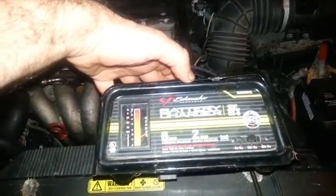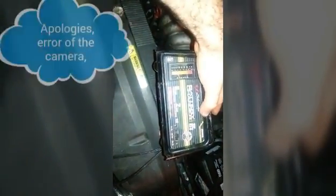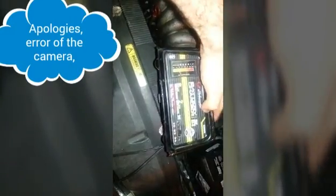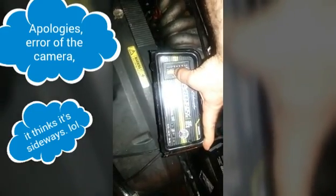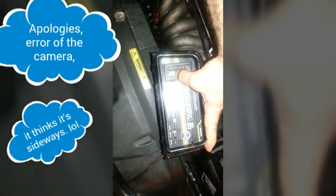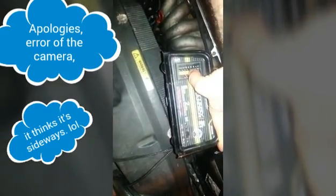Normally speaking I'd say this would be a win and the car would start, but I don't really even care to start it — the point is ending just fine. Those little interior lights you saw inside lit my way into the car real nice. But that just took a few moments and the battery is sucking down tons of energy again, so basically all I can get into it is a surface charge.